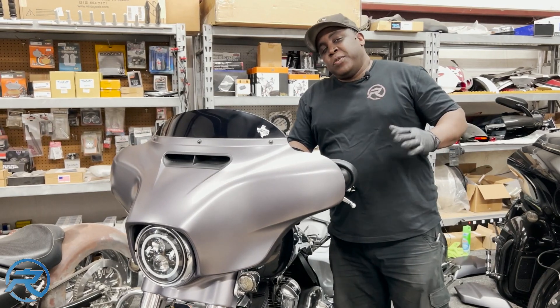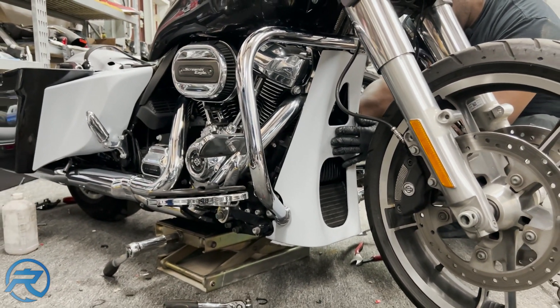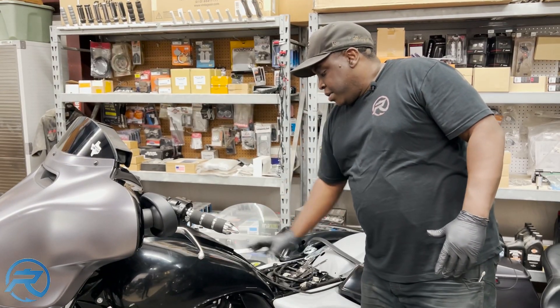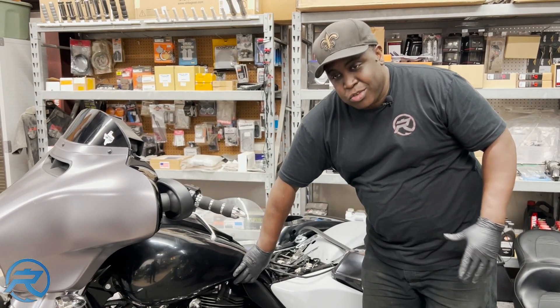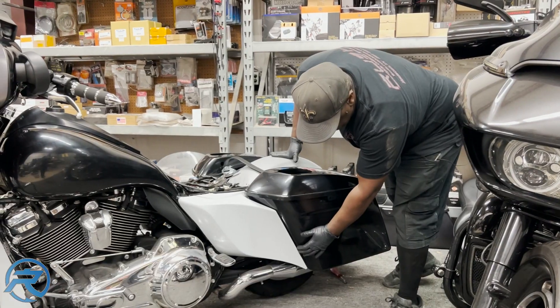Mockup is complete now. Everything fits really well. The front fender fits real good with the spacers that we already put on. The chin scoop is easy to install — one nut on the back side that you tighten down. Moving on to the tank shroud and tank cover: the tank shroud fits real nice on top of the tank covers, and the tank covers fit really well. There might be a little bit of modification and trimming on the tank covers to make them fit going to the back of the bike. Side covers are a really nice fit with the saddlebags.